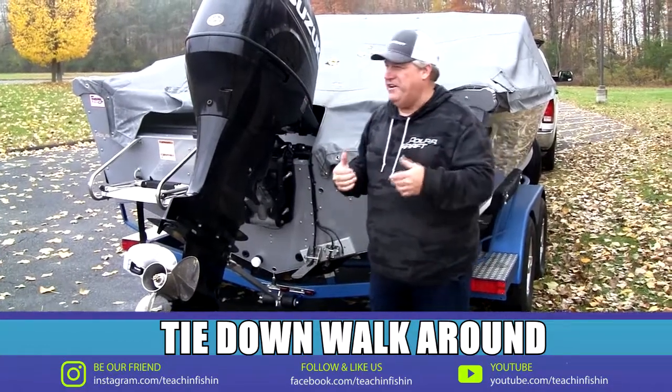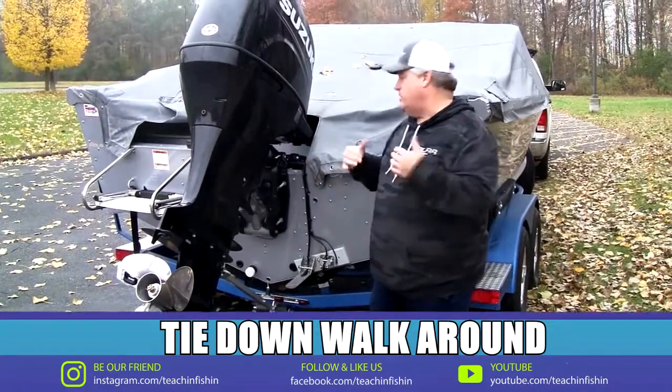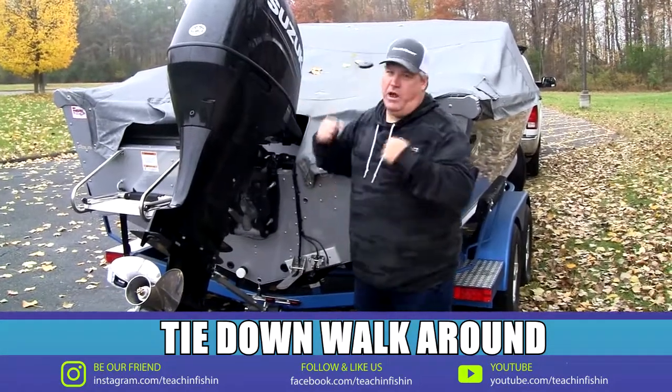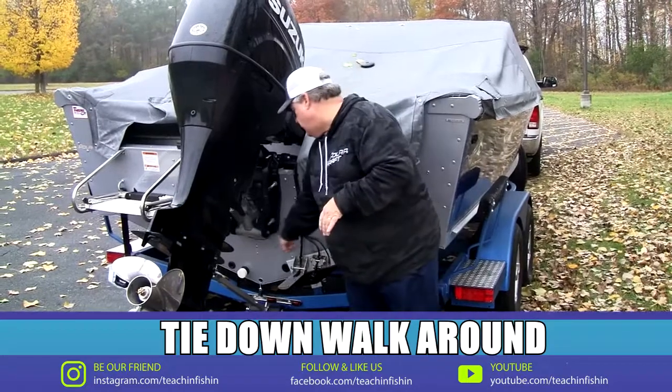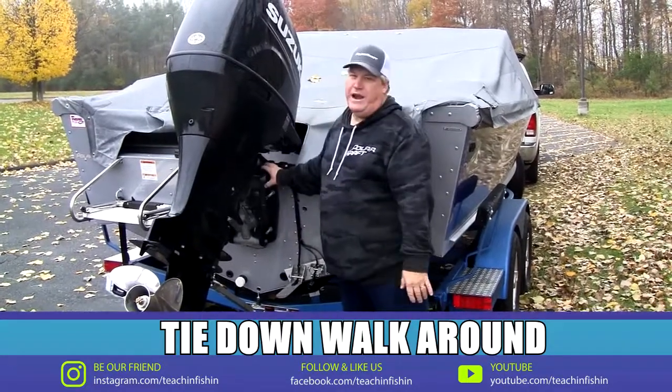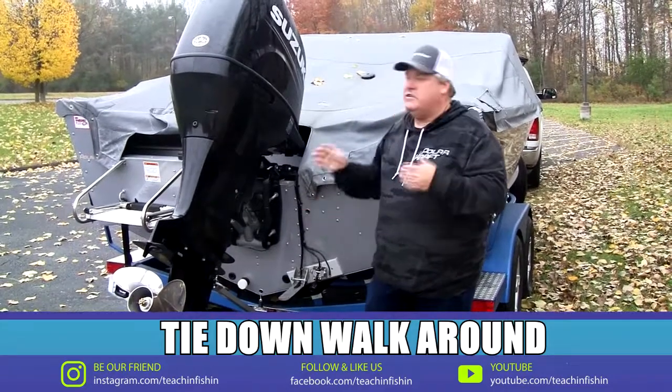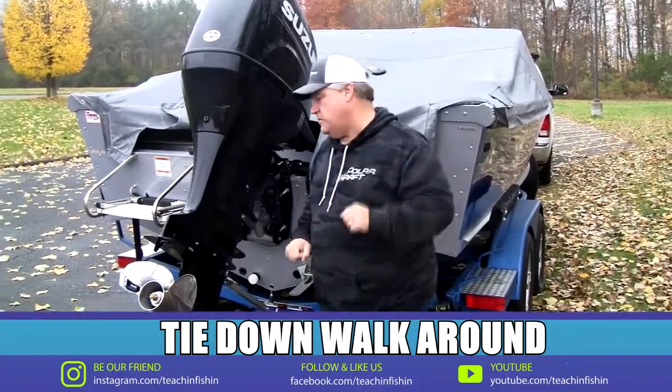And if you live in Michigan like we do, or the upper Midwest, you know the roads are terrible. There's not any shocks on a trailer. So all of that force of that motor going up and down on those crappy roads is now transferred to the trailer, not to the mounting bracket of the motor. So use a good motor toter. That's going to help you. It's going to save your motor, save your transom, and keep you safe.